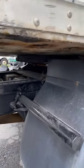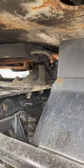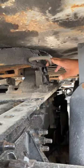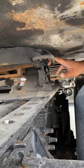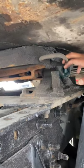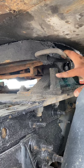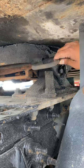We also have our release hitch. Our fifth wheel release hitch is in the locked position — not broken, not cracked, and not damaged. The mounting bolt and spring is not rusted, cracked, or missing. All the mounting bolts are intact.